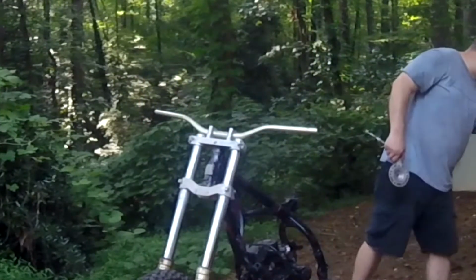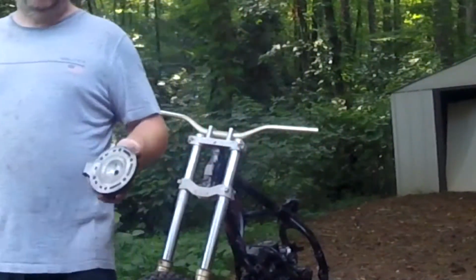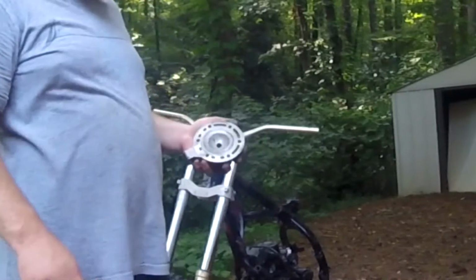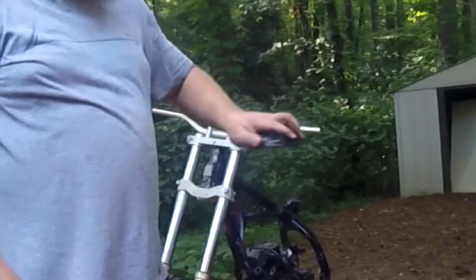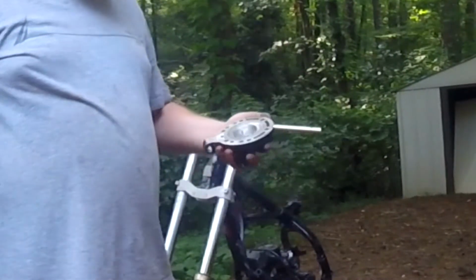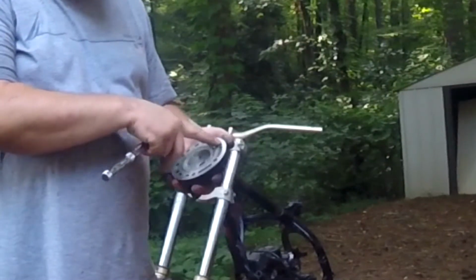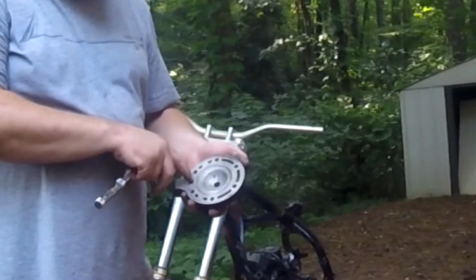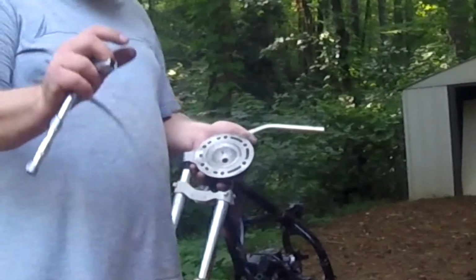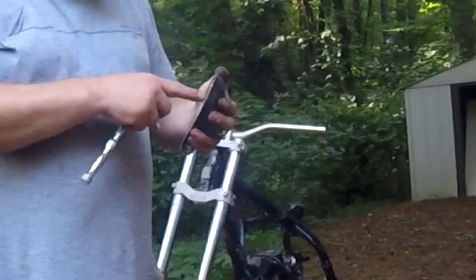A flat plate is a perfectly flat piece of metal that's machined to be perfectly flat, and you just put some sandpaper on it, and you just go like this with it. And you can do that with engine side cover plates, clutch cover plates, cylinder heads, whatever, and that makes a nice flat surface. If the O-rings or the seal grooves are machined into the head, you can't do that, because then you make the groove thinner and thinner and thinner as you work on it, and that's not good.